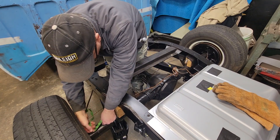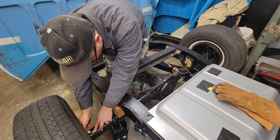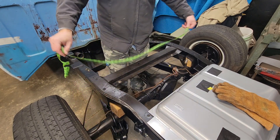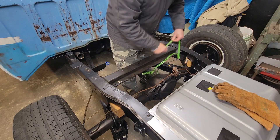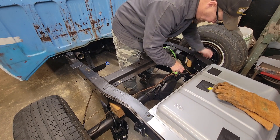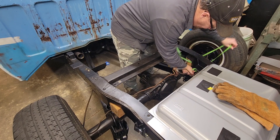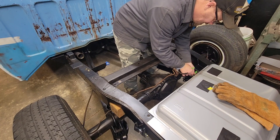Just follow your brake line around because we're not going to run it like this — we're going to try to run it a lot cleaner, look better. Right there is roughly 37 inches. Like I said we're giving a little extra to it. We'll leave about four inches off this side and chase this one around. This is just a rough measurement — just want to make sure you've got enough. I'm thinking around about six foot.